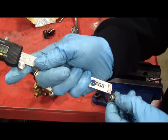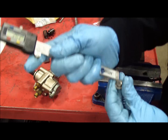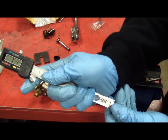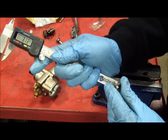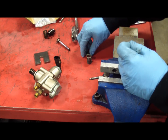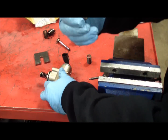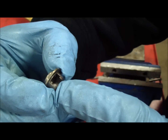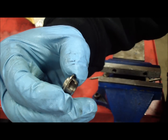If you want to check it for reference, the factory one is also about two millimeters. As shipped, we pre-assemble this, so when you get it, it's going to be right around three millimeters. That's fine — it's just started for you so you don't get it crooked. So it's about three millimeters when it comes out of the package, and when fully seated it should be right around two millimeters, plus or minus. The key is: when it's wide open as you receive it, it's going to drop inside to lock into place. If everything's nice and tight, you don't have to worry about damage to the retainer.